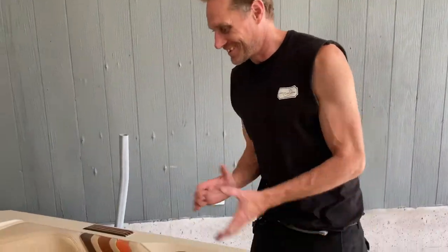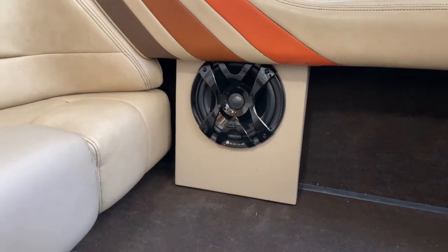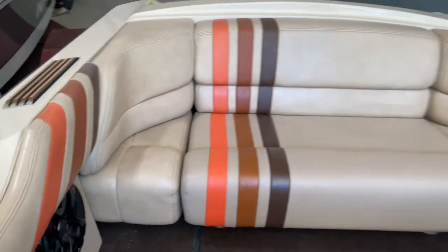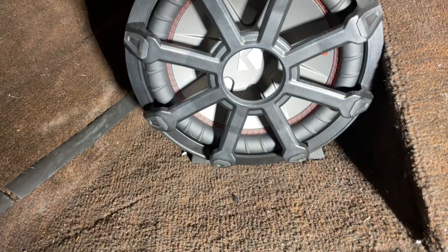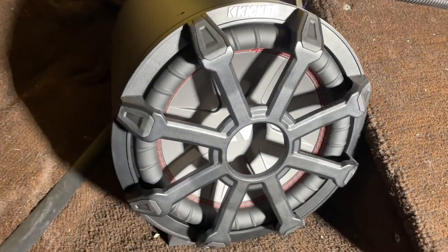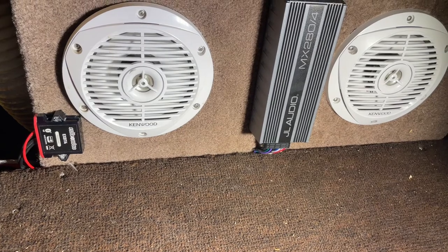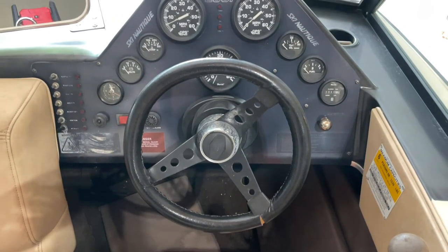Back inside the Nautique — look at this thing, it's looking minty. We've got a couple of Exile 8s into these little component bins right in the back here. Those got that same resin treatment as the kick plate that's built up in the front. Those are going to sound real nice and give plenty of sound out back with the boat. We got rid of that crusty old sub box — down there we've got a nice little kicker sub. And just to the right of there you'll see the kick plate with the amplifier. So it's a nice, small, really simple system — four speakers, sound in the front, a little bit of bass, and a Bluetooth dongle so everything's controlled directly from your phone. There's no head unit in this boat, there's not even a space for one, so we had to get a little creative with it. This is what we turned out with.